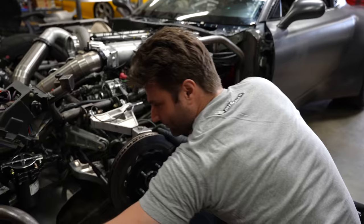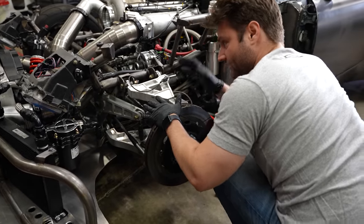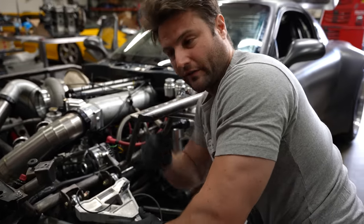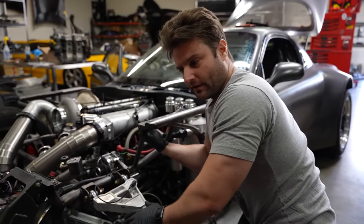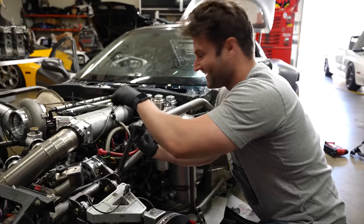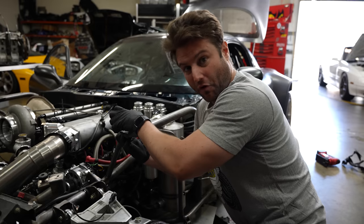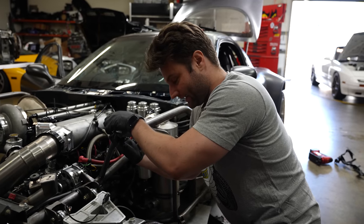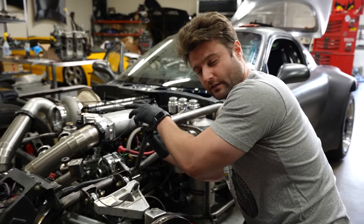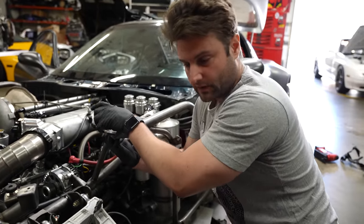Finally, getting the last little bit connected for the front ABS wheel speed sensor. So this now means that we have at least one wheel on the front and one wheel on the rear, albeit they're on opposite sides, which could cause issues a little bit, but not too much while we figure out our traction control. Ultimately, when I fix the wheel hub on that one and this one, where the wires are shredded to pieces, then we have all four wheel speed sensors working. But it's beautiful. You saw it earlier in the video. The important part is Haltech doesn't take into account the size of the tire. All it focuses on is pulses per mile or pulses per kilometer.